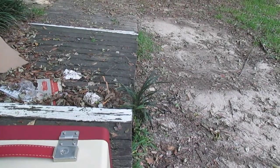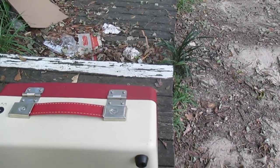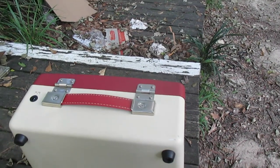The problem with ceramic cartridge-equipped Crosleys is not so much the fact that they use a ceramic cartridge — it's the fact that the amplifiers are poorly designed and not properly impedance-matched to the cartridge, and the speakers are crap too. Back in the day, they had some mighty fine-sounding record players that used ceramic cartridges, but those were all well-designed.